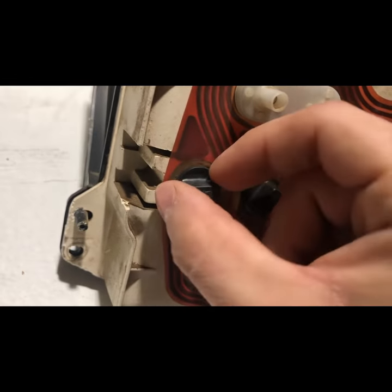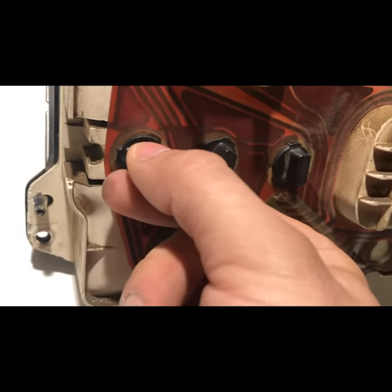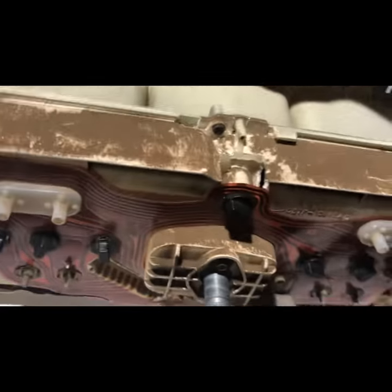There were more spots behind the printed circuit that I also hot glued, but there were a whole bunch of spots that I glued, and as a result of this cluster rot, a lot of my dash bulbs are loose or they just wouldn't stay in. Like this high beam indicator — I had to completely rebuild it in order for it to stay in. I repaired it the best I could and decided I would try to find a replacement down the road.